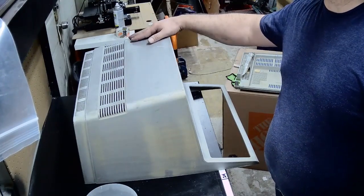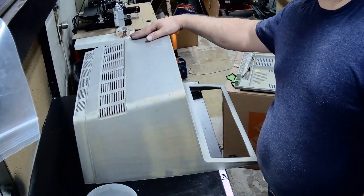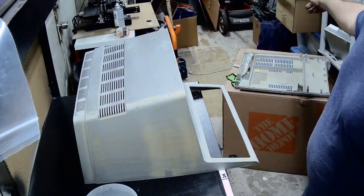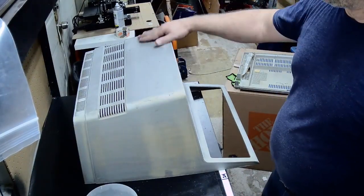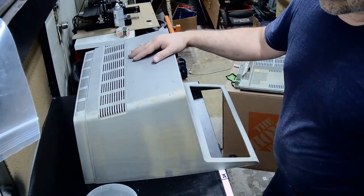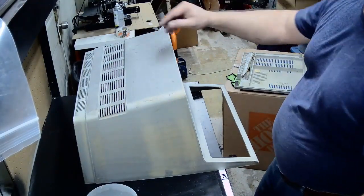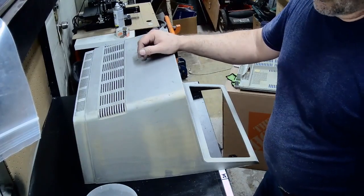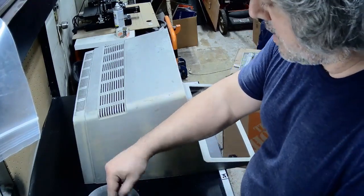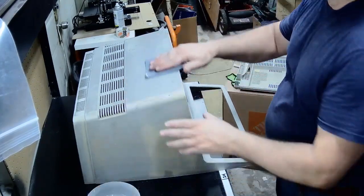I do a 1500 over there to clean all these little tiny bumps. Then when I do my primer, I will only find some light bumps, and I will wet sand it again, like I did for the other case, for whoever missed it this afternoon. And then you'll see it in the next piece I will do. Once it's done, I will sand the primer, wash it with a hose, and let it dry for a day. Then I will paint it like I did that one, except it'll be painted Radio Shack Gray, or whatever you want to call it. I don't know the name of that color paint. People call it all sorts of names, and actually it's not Radio Shack, it'd be RCA Gray, I guess, since it's supposed to match.